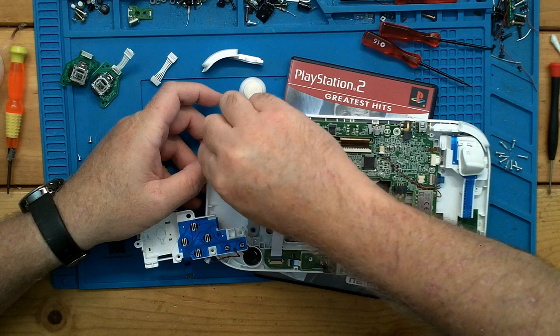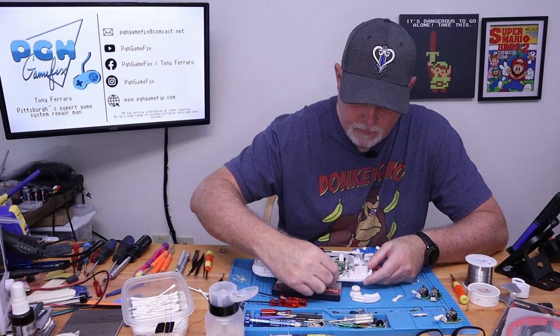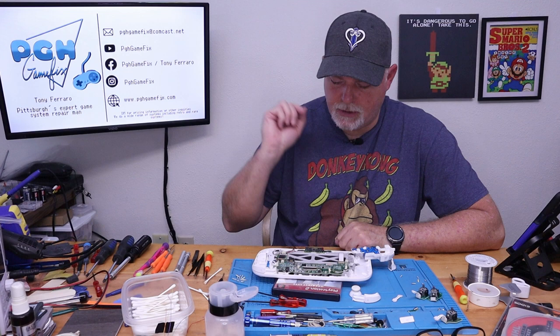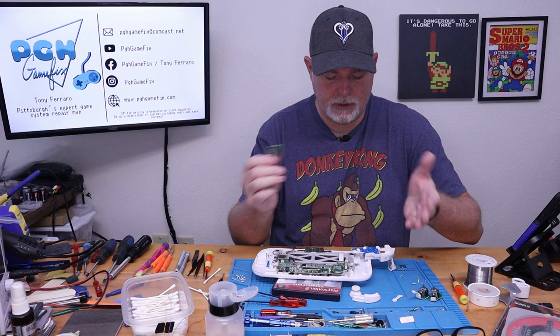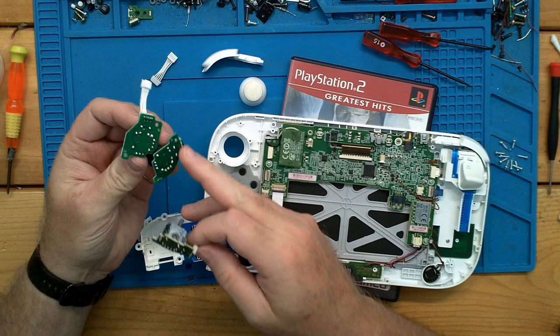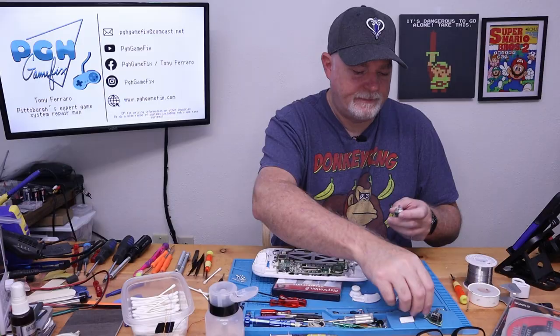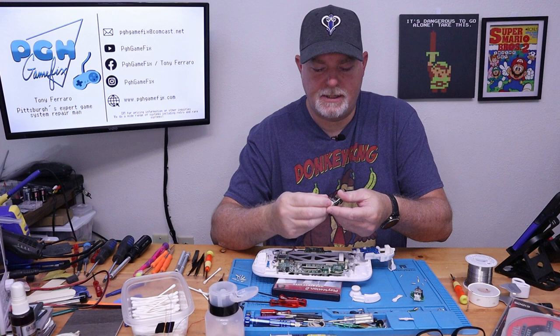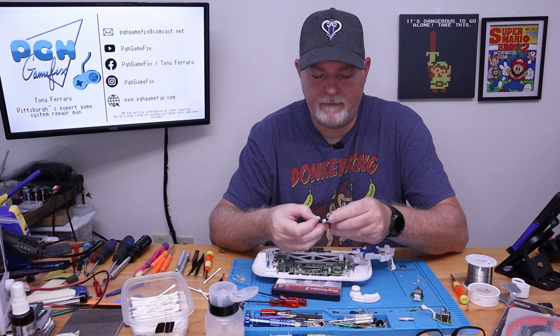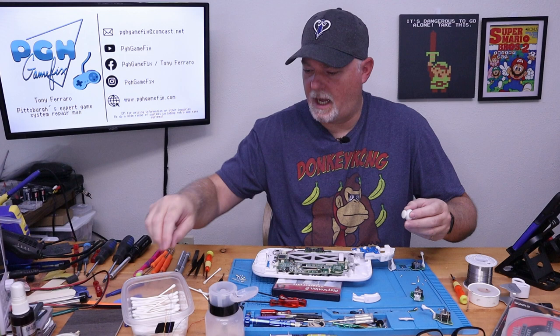That isn't too bad. There's some goo right there too — that's obviously where the slider goes. So that's clean. Now we just need to see which one of these. So this would be the right one on our left, and there is a difference between the left and the right — you can see how the boards are built. This is the one that came out and this is the one that's going in. These ones look like they have been replaced, or at least it's a style that does have a plug. There are some where the wires are soldered directly to the board, so the little ribbon doesn't come off. I don't know the history on this — it's a customer unit.